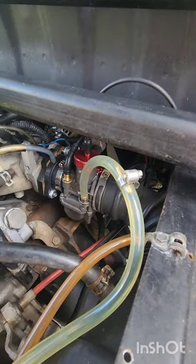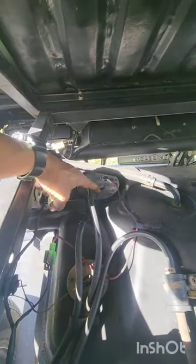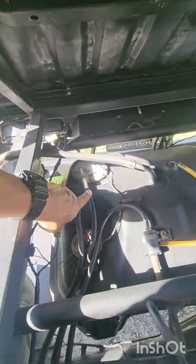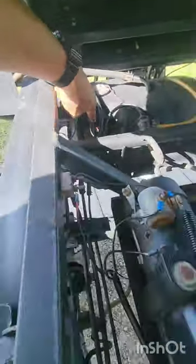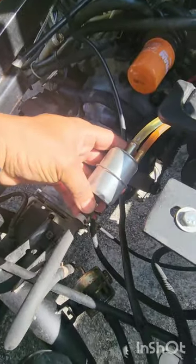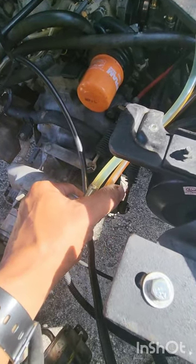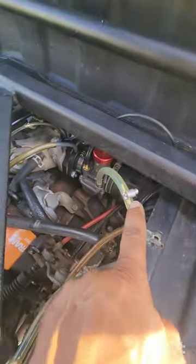This is how it came out. Let me explain what I did. The fuel pump of this truck is about four to seven PSI. This is the line that comes to the carburetor and this is the return for the original one. Now it comes right over here. I put this filter when I bought the truck, and I added this filter right here to reduce the fuel pressure. This line is the one that goes to the carburetor and the darker one is the return.